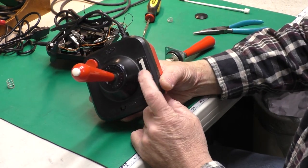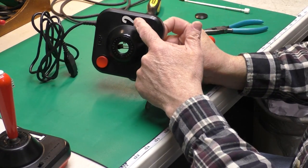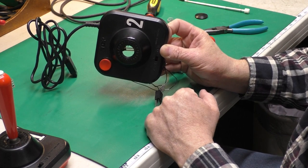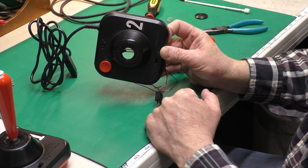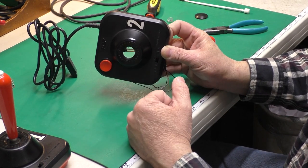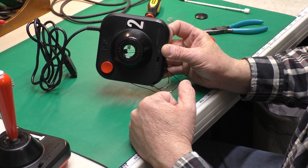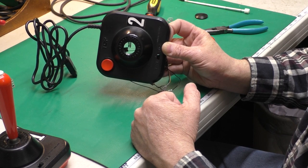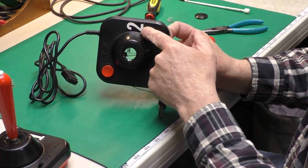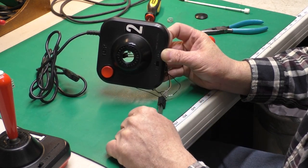This joystick has a number one sticker, which means the other one has a number two sticker. All Commodore fans will know that most games were set up to use the number two joystick port — maybe because it was the lowest memory address. After one occasion where either my sister or I blew one of the CIAs by static electricity unplugging and plugging in a joystick, we got a second joystick and my dad put stickers on them. We kept them plugged in, but knew which was which because of the stickers.